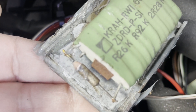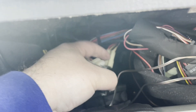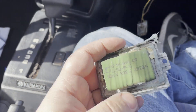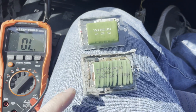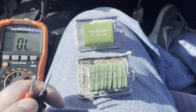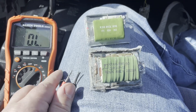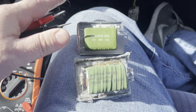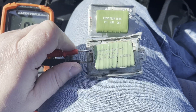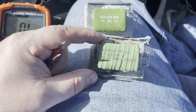You can see the resistor on the end here is not good. With the part loose I'm going to unplug the little connector — with the connector tab depressed I was able to remove the old resistor. Here's the old one and here's the new one. Here's the resistor on the side which is typically what goes bad. I have my multimeter set for continuity — when the two probes touch each other they beep. If I take the new one and touch the ends of the resistor I get the beep, meaning there's continuity within the resistor. I do it on the old one and I do not get any continuity, which tells me this resistor is bad. People will solder this off, buy a replacement, and solder the new one in, but this was cheap enough that I'm just replacing the whole thing.